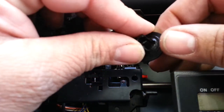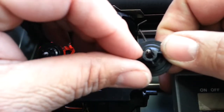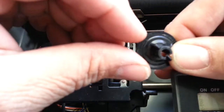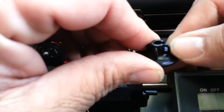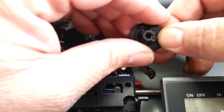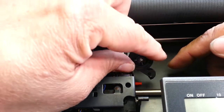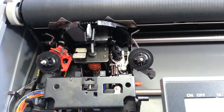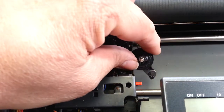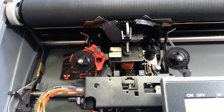I have already investigated this and it's got a broken plastic clip. It should have a clip right here, right there where that gap is. So I found another one and it's got a good clip — there's the clip right there with my thumb. This should just snap back on there; it's got a little pawl that goes around it right there. We can get this on by just pushing it down, pulling the pawl out of the way, snapping it down — and that one stays in there.